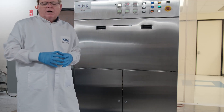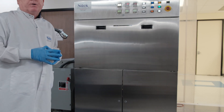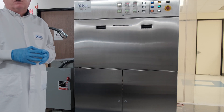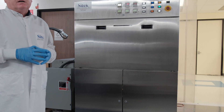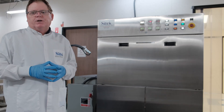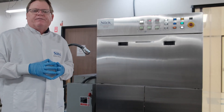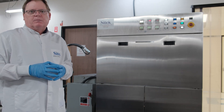Normally on the wash cycles they're much shorter. Because of our burn-in time, we put long wash cycles on. Most customers usually run between 30 seconds and 90 seconds of a wash cycle. Part of our burn-in process, we use extended time — especially on the cleaning — to make sure there are no leaks in any of the valving, the pump, the spray arms, etc.